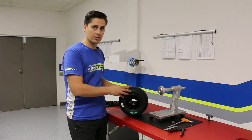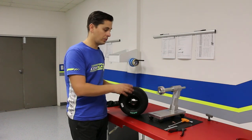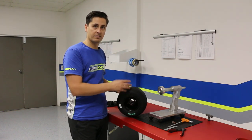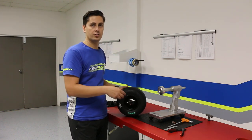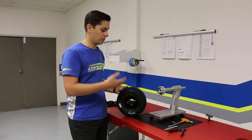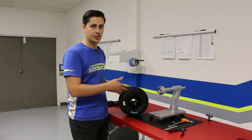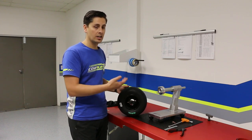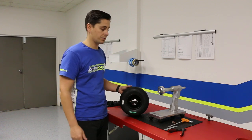What we're going to do is balance our tire, much like somebody would a car tire. The importance of balancing your tire comes down to a couple of reasons. One is obviously vibration. An out-of-balance tire is going to create vibrations in the chassis which can affect corner handling and your straight-line speed. With the vibration you're also going to get inconsistent tire wear, tire degradation, and things of that sort. Even an extremely out-of-balance tire can actually be physically tough to drive on because you will have vibrations up through the steering wheel.